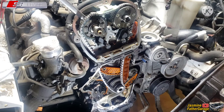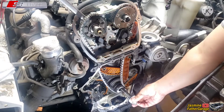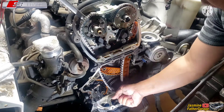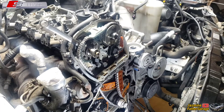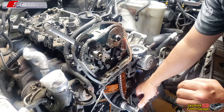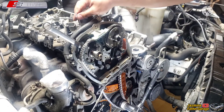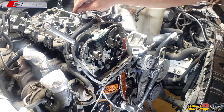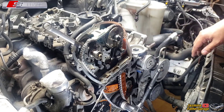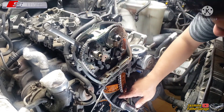This is the best time to put the spacer on and the crank bolt right here. This came with the kit — you put it on like that so it won't damage the grooves. We use a 15/16 socket to turn the crank — nice and snug. I've got a little wire here in cylinder number one; this is what guides me to confirm I'm really on TDC. If I turn this crank, the wire will go up a little bit. When it stops while I'm spinning and the wire stops moving, it's on TDC and I'll check the mark.